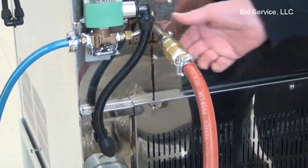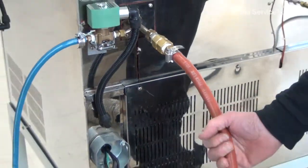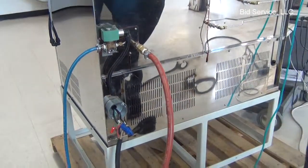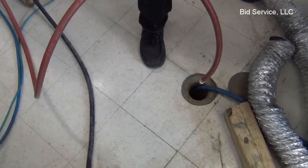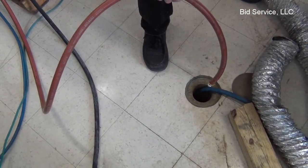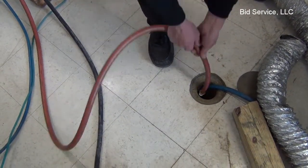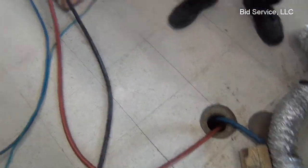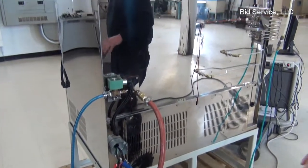Importantly, there is the return or drain line. This drain line cannot be pressurized in any way. It must go to a floor-type drain, because once the cooling cycle starts, it will emit a short blast of high-pressure steam. Once the cooling cycle is underway, it will cool down, and eventually the water temperature will come back down to room temperature.